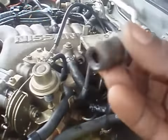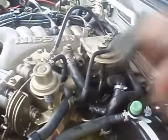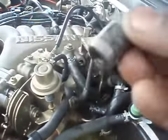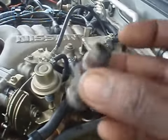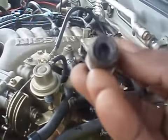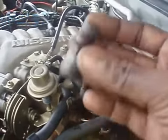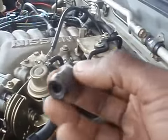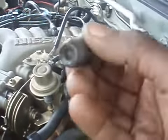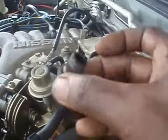When we look inside the old valve, we can see carbon build up into it. And you would shake it — this one, the ball still rattles, so that means it's still in operating function. Once the ball stops rattling inside the PCV valve, it means that carbon has completely built up inside its passageway.